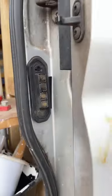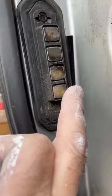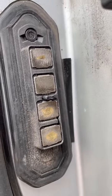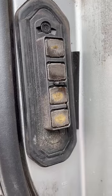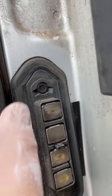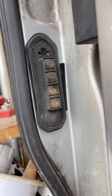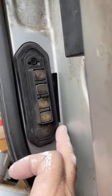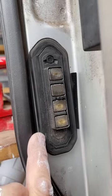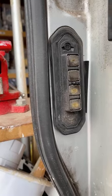So this is the door sensor with the door open — look in here. I was about to spend £40 on a new one because it was looking a bit worn. The problem is it's very loose. You get a little screwdriver, just pop that pin out, the whole thing pulls out, and it's very very loose. All I did was pop it out, get two pieces of double-sided tape — one on that side, one under that side — put it back in, push the pin back in. Came to work this morning, not a peep.